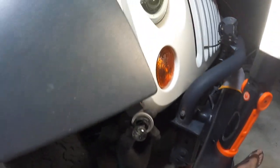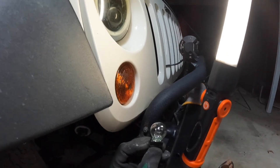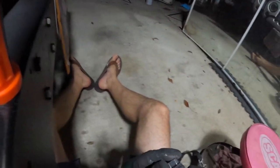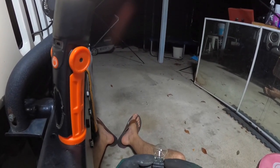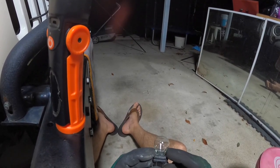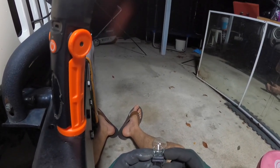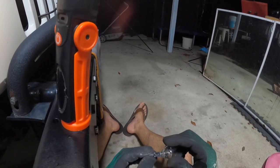It's got two little tabs on either side. Push one tab out and pull at the same time and that will release the bulb. Check your bulb to see if it's burnt out. This one is a Multi-Lit 12 volt 27-7W — so that's a 12V 27-7W — I'll put that down in the description below as well.